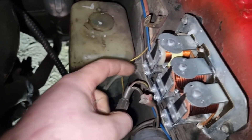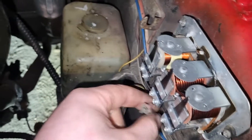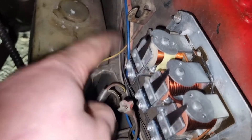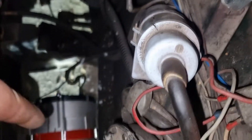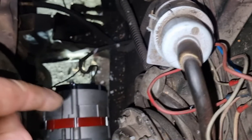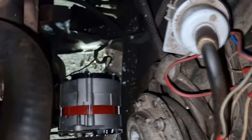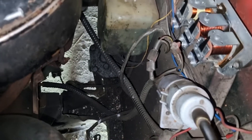I need to put a connector on this and hook it up to the one which goes to the alternator. So when I put the ignition on, I have 12 volts here - this is going to be the ground side of the light. So I have ground from there, up through this wire, into this one, to the lamp - the light will be on. I start it, 12 volts coming through from the light will magnetize the alternator. The alternator will start charging, loses its ground, puts 12 volts through that wire, and the lamp goes out.